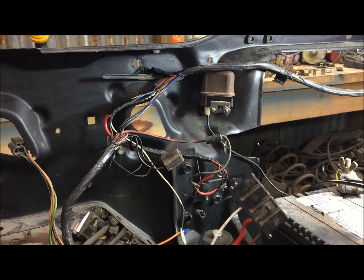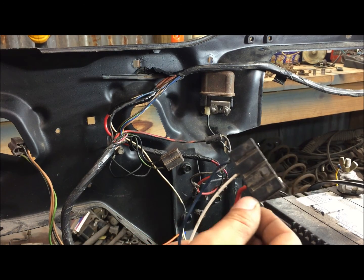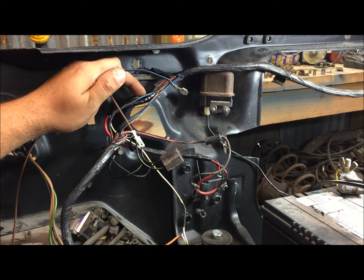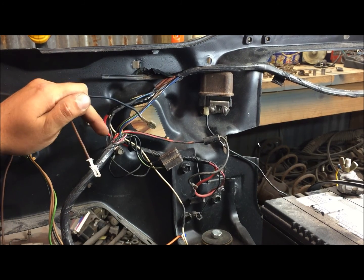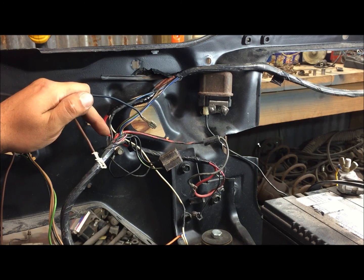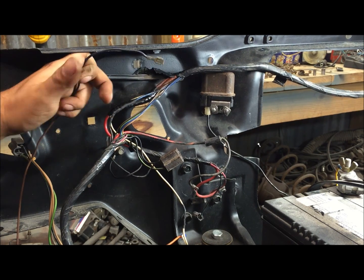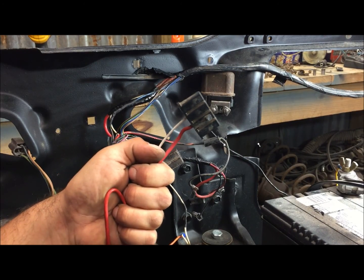So let's talk about that. Take your plug — we're going to start by pulling F and 4 out: the blue and brown wires on the ends. Strip back your harness and you're going to find the blue wire coming from the number one position — this is the exciter wire on the alternator — and then you're going to find the brown wire going back to your dash, the number four position. All you're going to do is split the harness open and find these two wires, then splice them together. That's it. Now we've got two left — 2 and 3.